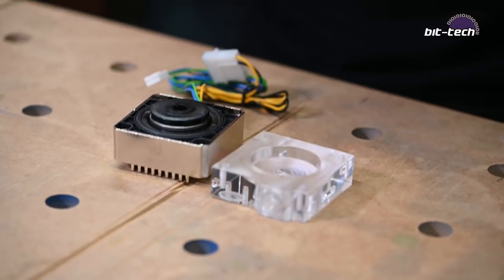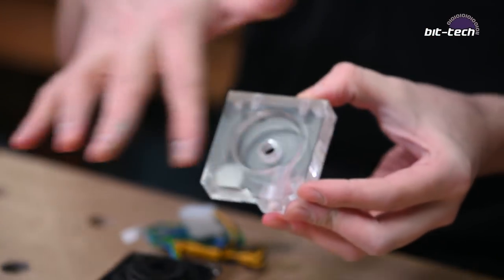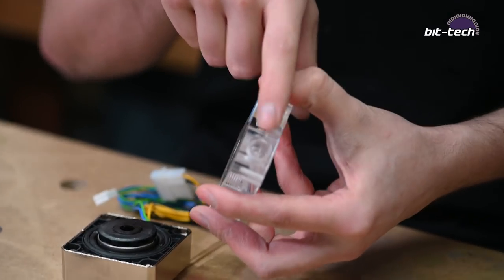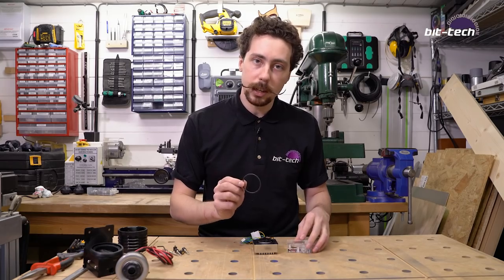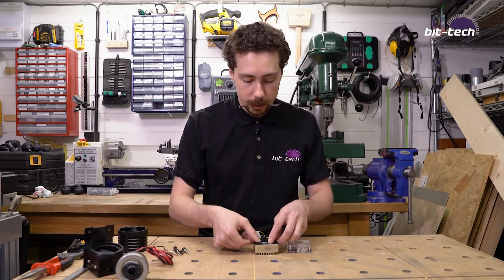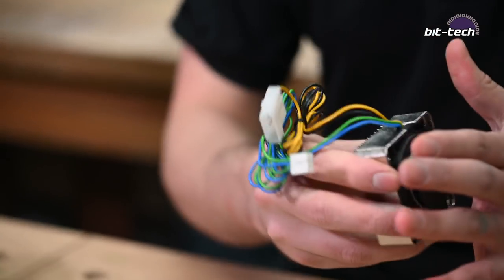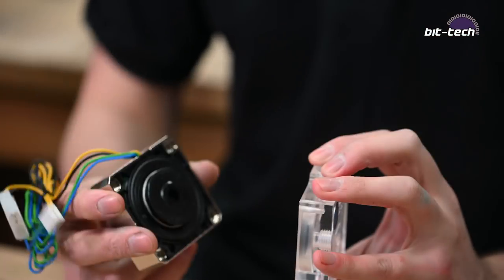Because the DDC is just a shallow disc you can machine it quite easily from this side, and on this one you can have a channel coming in from the top instead of the side. If you're doing this yourself you may want to have the channel up here on the top. For the DDC, you take the o-ring in the pump housing itself, then screw it into the distro plate around the back with a cutout in the plate — very very simple.